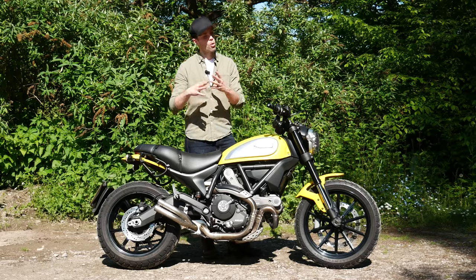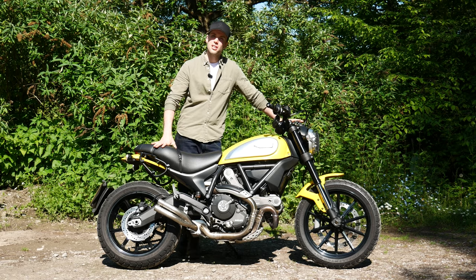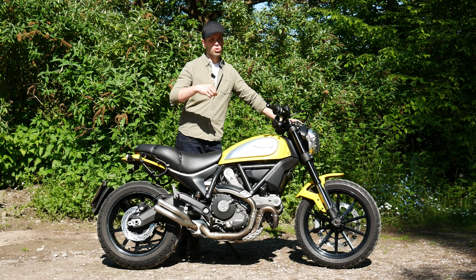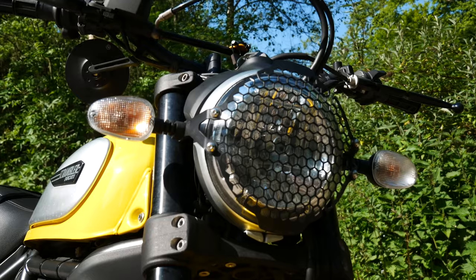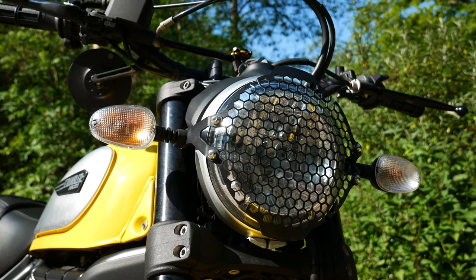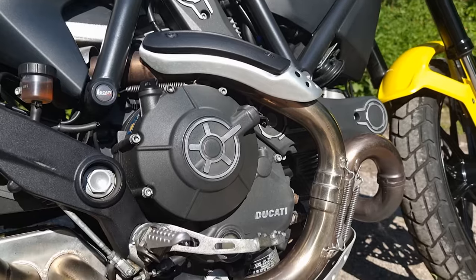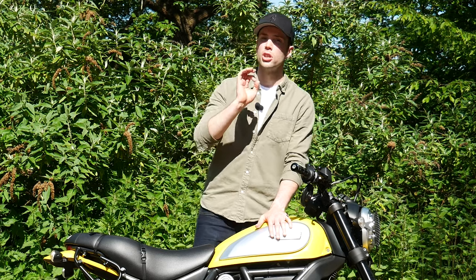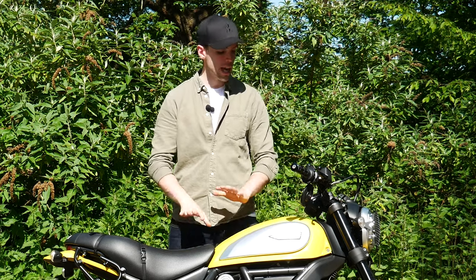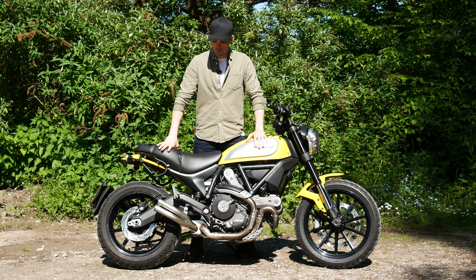Another thing, with a small batch from the factory, is that the clutch was tightened too much — they didn't leave any play in it, which meant it was slipping the clutch to a certain degree and would wear it out quicker than it should. As long as you check your own bike and leave a little bit of play in the clutch lever, you'll be absolutely fine. Even though it burned a pretty substantial bridge early on, since that point we've been getting on fine and it has been very reliable for me. I've got no kinds of problems with it.